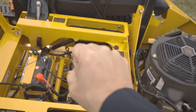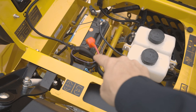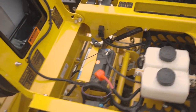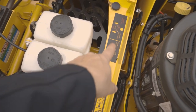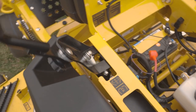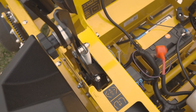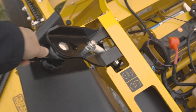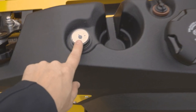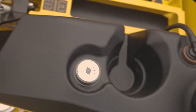The battery is centrally located — we like to keep all of our weight in the center of the machine so it turns easier. On this newer machine, our battery tap for the harness comes right off the battery side rather than off the starter, which is easier to get to and a little more reliable. We've got some cheat sheets in here covering the belt path and fuel flow. The hinge on the controls is real wide and strong, with a real strong over-centering spring so your controls snap into position — all real thick material. We've also got a cup holder. The fuel gauge is actually a compass-style gauge — I'll pop it off and show you what's going on.